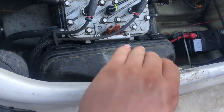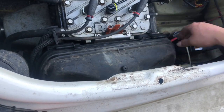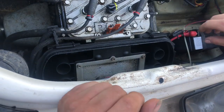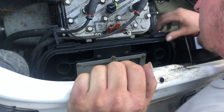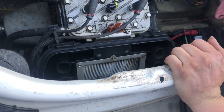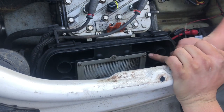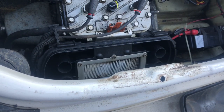What we're going to do now is remove the top of the air box. I already undid these clips that slide, so you slide the clips and then you can pop the top of the air box up like so and get the top of the air box out. Once you have that out, take those two screws loose there and you can get the one bracket off. I'm not sure - I might have to take them loose. I haven't taken apart one of these in a while, so we're going to see what we can do.